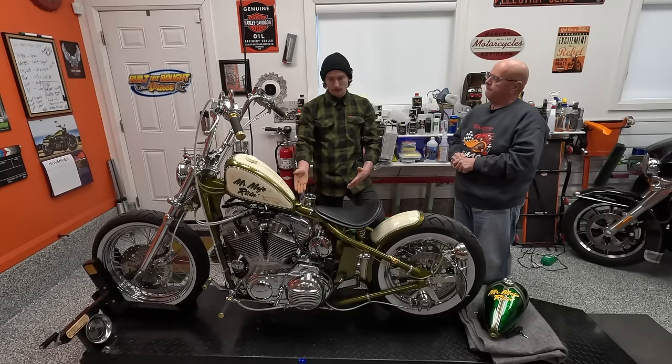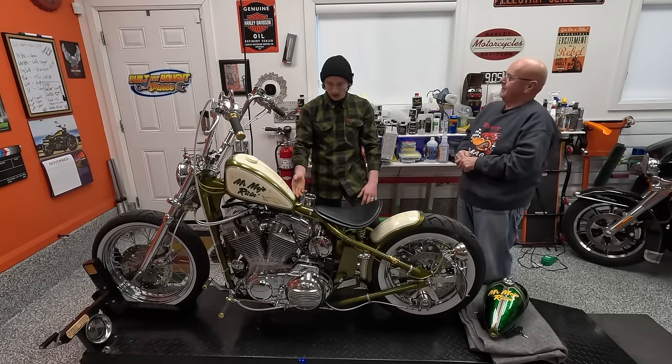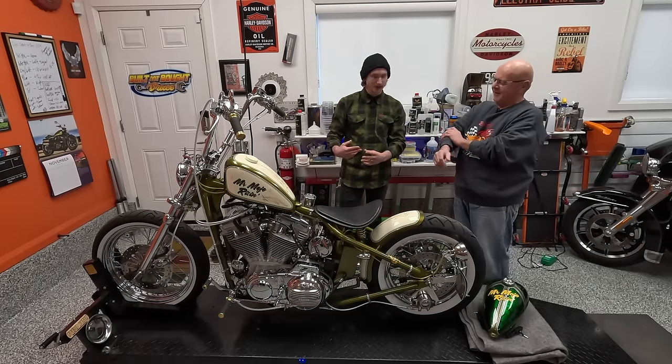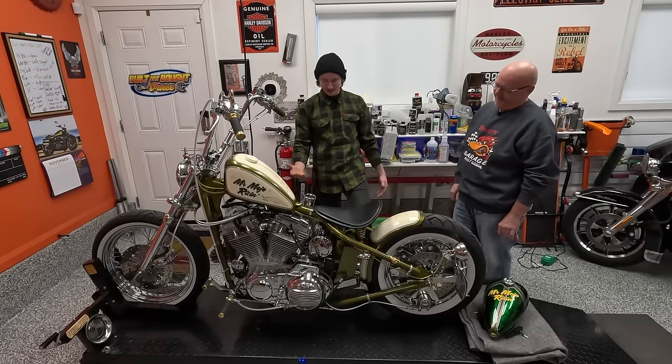And just for extra care and love and affection, I got some cool leather washers from Lowbrow. Slipped one of those in there. So now the tank is very solid - flat surface on flat surface with that little leather washer between there. No chafing, no rubbing, no shifting, no nothing. The only difference is the tab now sits about three-eighths of an inch up off the backbone, which I find totally acceptable.